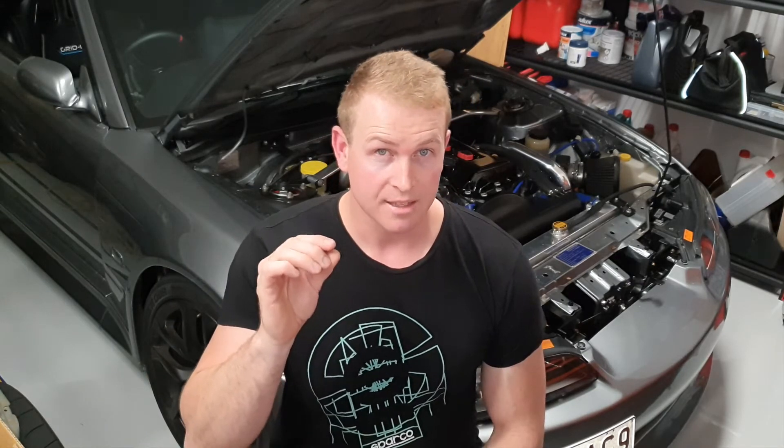When I tested my motor previously I'd barely driven it and the compression pressures at time of test were pretty much low and even at the minimum spec, so I was a little bit worried. Bear in mind my motor has a metal head gasket — the thickness is slightly different and it's been skimmed, although I'd have expected that to slightly raise the compression. I haven't tested it since, and I've now run it six drift events, so I'm really keen to see where it's at. Moving to higher horsepower, we need to make sure those compression numbers are nice and even and not too low.